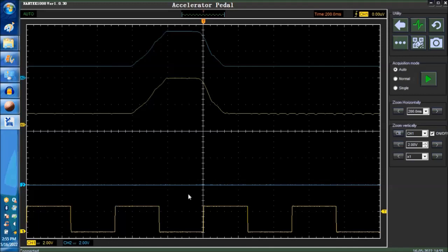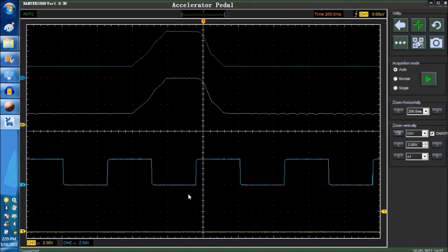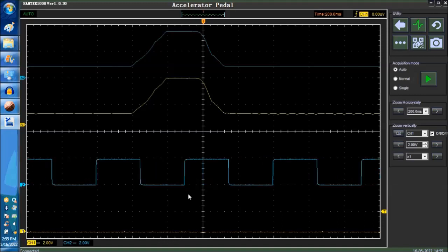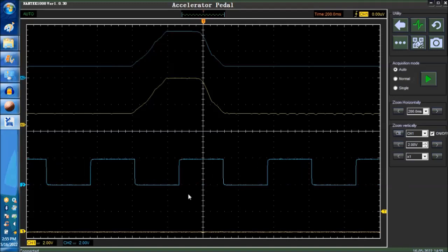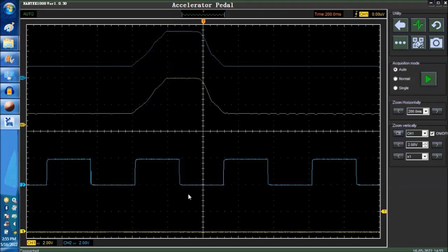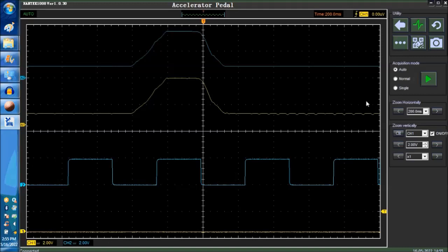These outputs are important because they are redundant. We have drive-by-wire systems right now, and with drive-by-wire systems you need redundant APP sensors, because in case one of them fails, you have the other one. That's why it's called redundant. That's why we have these dual signals. Sometimes it's a triple signal APP sensor. Now, going back to the video here,